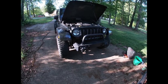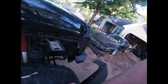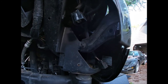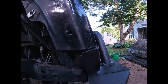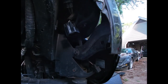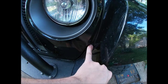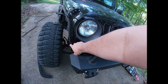This fender actually comes loose right here. This hole in this bracket is slotted, so you can actually push this fender in at the bottom to close that gap quite a bit. I think if I trim a little more off the backside of the grill, I'll be able to get this down flush right here — it'll be real close, real hard to notice. I pushed that in quite a bit and you can see how much this closed up compared to where it was. This won't match completely, but this outside line will match great.